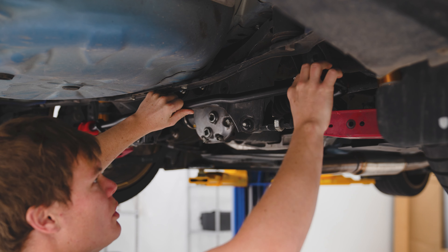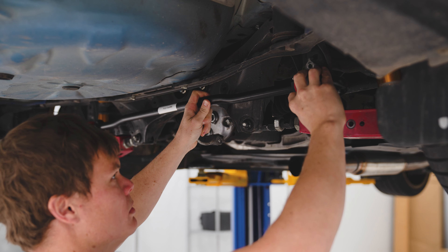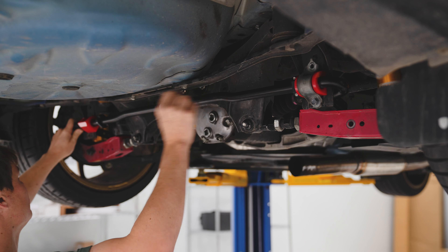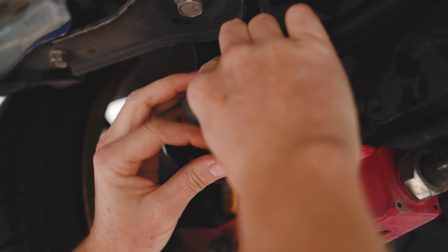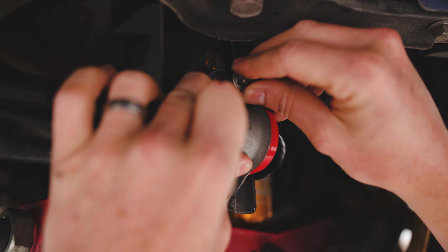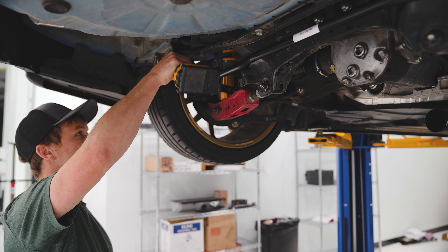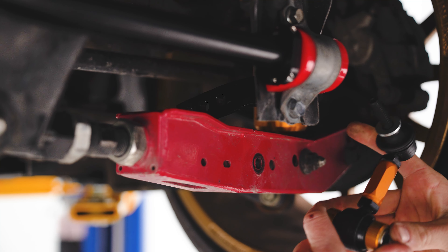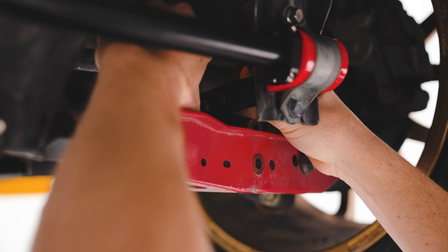Grab your metal brackets and install those over the bushing. I'm going to use just one piece of hardware for now to hold it in place and then do the other side. One thing to pay attention to is that this tab on the bracket goes in the hole up above. Once the sway bar is held loosely in place, add the upper hardware so that it is attached securely to the subframe. These aren't included in the kit, but I'm going to be installing some Whiteline end links to complement this Faction Fab sway bar. I'll put links in the description down below where you can find them on the website.